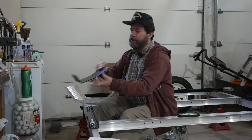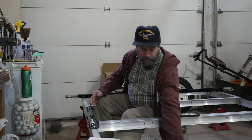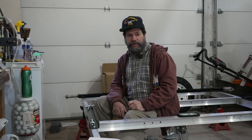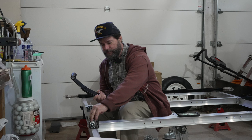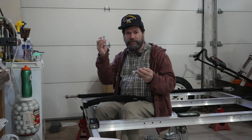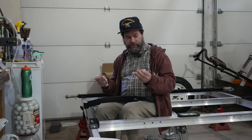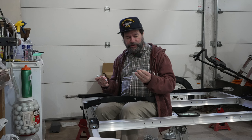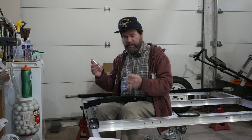I'm not going to be doing that because I'm planning to put larger tires on the trailer and they won't fit under that fender, so I'm going to skip that part of the instructions. The next thing they tell you to do is put on the wheel assemblies and the axle. First, we've got to put on the spring. The spring takes two bolts — a smaller one and a larger one. Almost all of the nuts and bolts in this kit are the same size, but there are three sets that are different sizes. This is the largest size and this is the next to the smallest size, and that's what we're going to use to put on the spring.